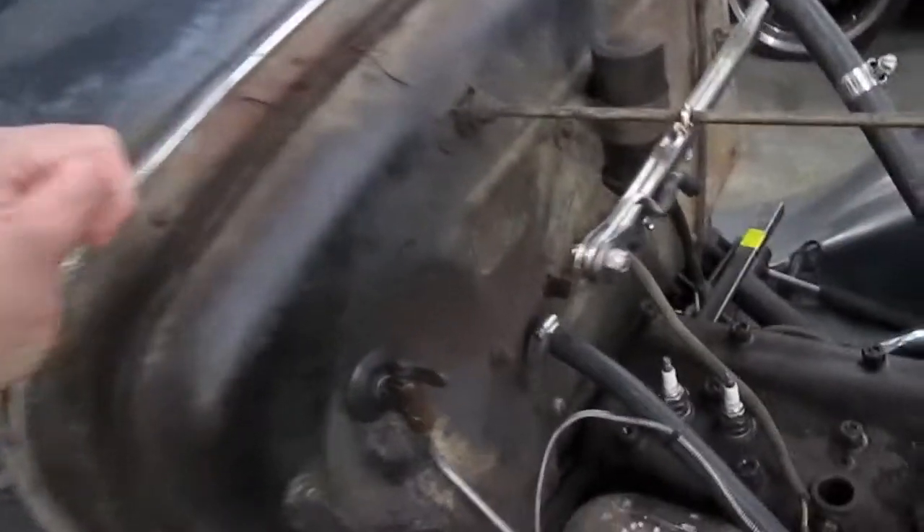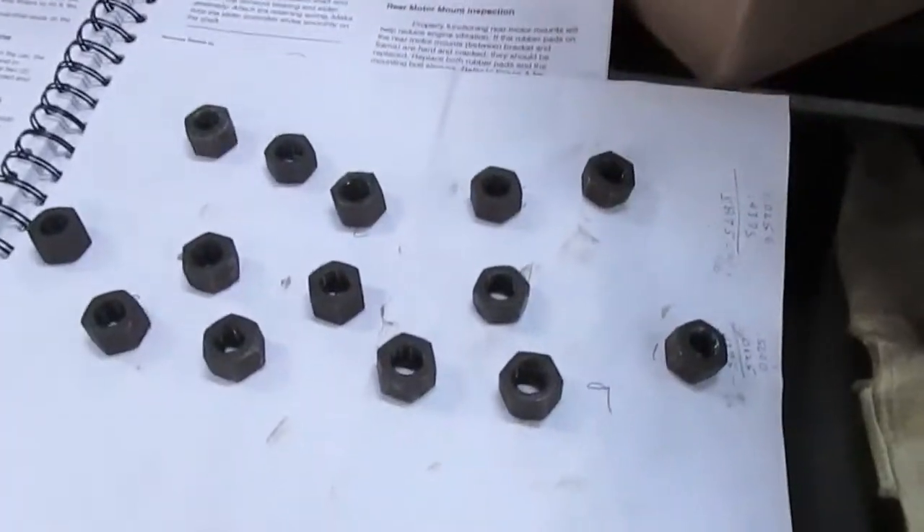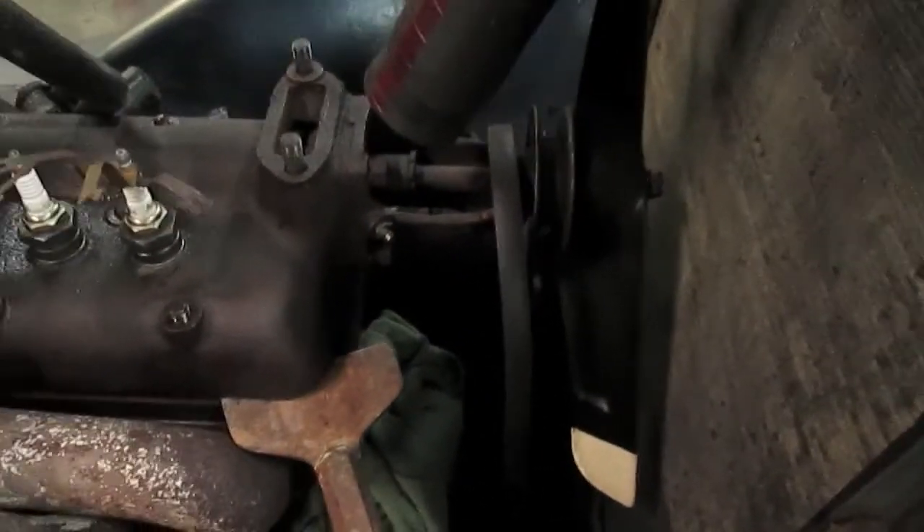Quick Model A update — we've got the wedges going in at the corners. We're going to see where they're going and keep tapping them to try to get the head off. We're making good progress. The back wedge is going in partially on the back edge, and the chisel with pressure over here is making good progress too. We've taken the bolts off and numbered them in sequence around the head. We're about to take the fan belt off so the whole thing will come off.